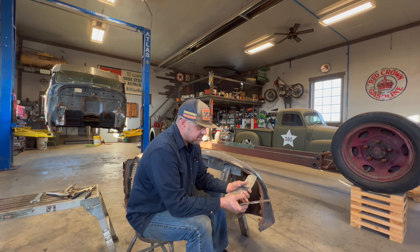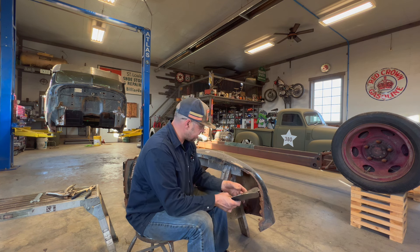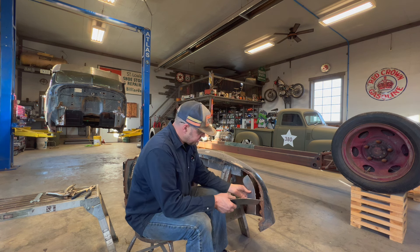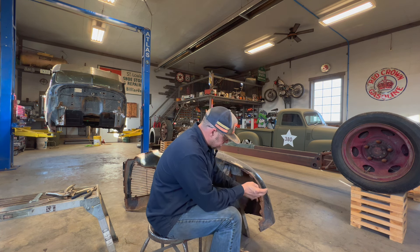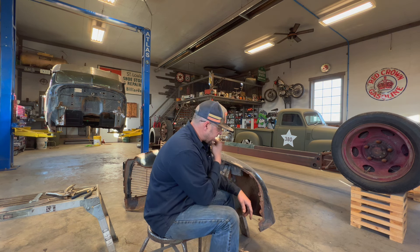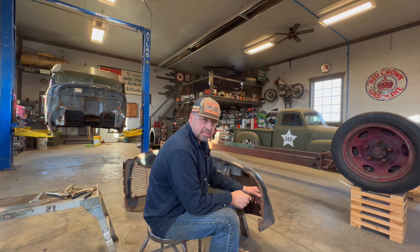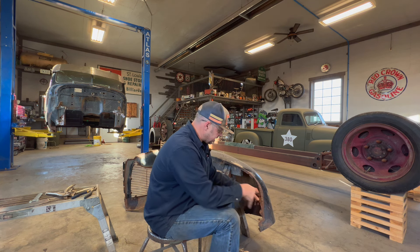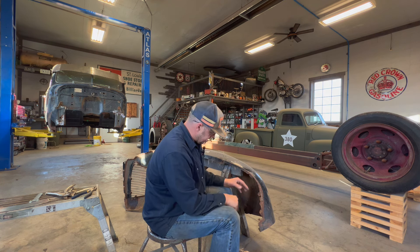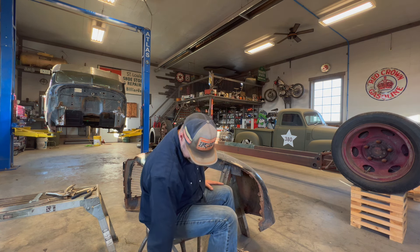I used a little on the heavy side of material just because these old fenders are kind of heavy. This is a little heavier, but then I'll have something good and solid there. Anyways, someone had looked like they'd brazed this fender - there was brazing on the body as well. Someone had brazed this fender to the car. So I just got to clean that up, clean this edge, and then I can go ahead and start welding those pieces in. Let's get after it.